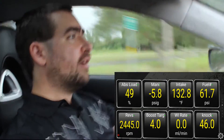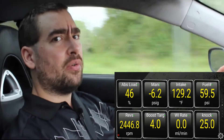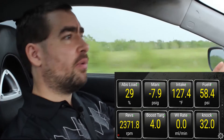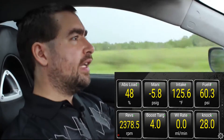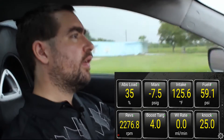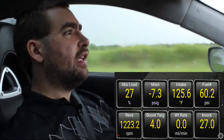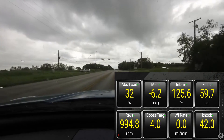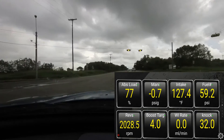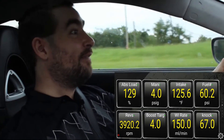The other thing is that rotary engines have a problem clearing water out. So if you spray too much at too low an RPM and too low in air flow, you can have the water get flung out into the spark plugs and cause misfires. So I can either lower my water injection rate, or I could actually increase the dwell on the coils — the coils can handle it. First, I want to make sure this isn't an actual spark plug, coil, or lead issue. But this is looking good so far, and this is only 4 PSI.